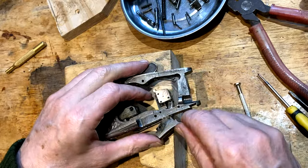All right, okay, so now I can offer that up with the spline side on the outside. There you go, partially in. Give it a tap and it does go in already. There you go. Just take it home, otherwise that'll catch, and then drop this one in and align the same, but with the spring working constantly against you. I probably got it the wrong way around.